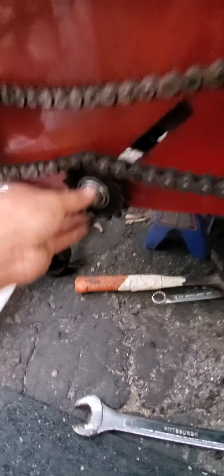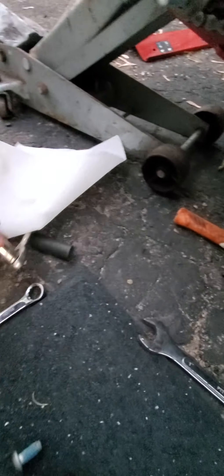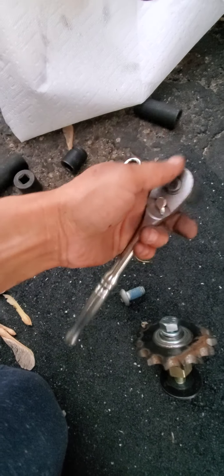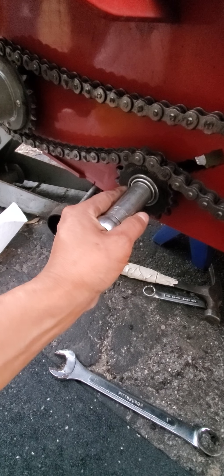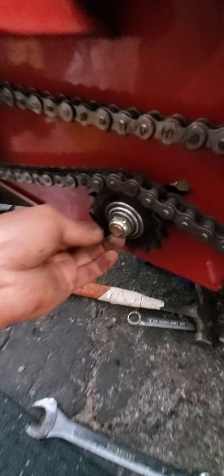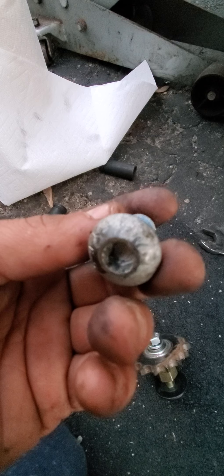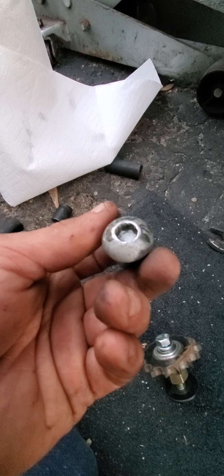To have easy access I like to loosen this one. You need socket 19 — you go loose, just get it loose like you're loosening a bolt, and to tighten it just go higher. I don't have any problem with this one because it has a lock nut. But this other one gets loose, and the problem is you need a special socket tip for it. When it goes right here you hit the frame, so you're not able to put the ratchet in there.